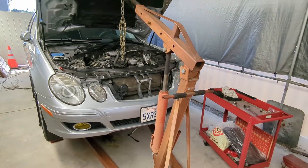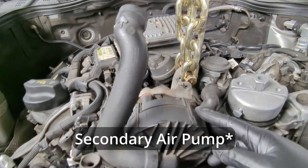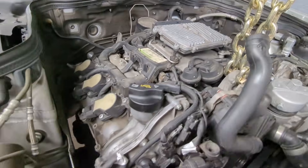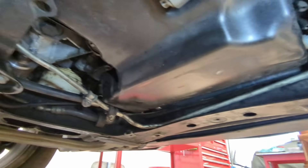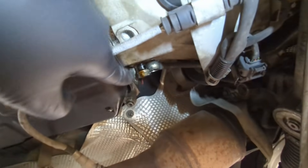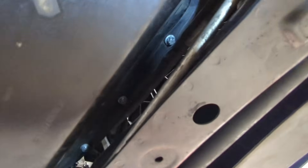Quick rundown of the setup: got the engine hoist. Had to pull the belt off just a little bit to access the bolts for the secondary air compressor so I could put a bolt through the front engine lift point. Got a heavy duty chain. Two motor mount bolts on the bottom side of the subframe are disconnected and I lifted the engine up about three or four inches. So what I ended up doing is disconnecting that transmission cooler line from the transmission — it was easier that way. It's a banjo bolt, and I was able to shimmy it out of the way, resting on the subframe, and that gave me space for those three bolts.